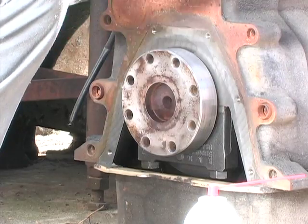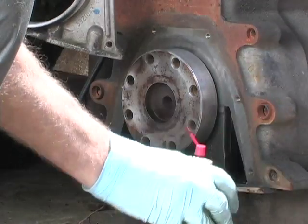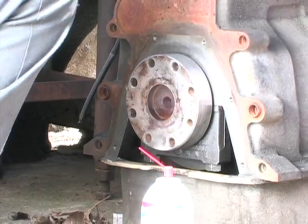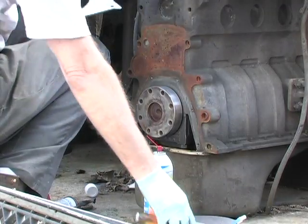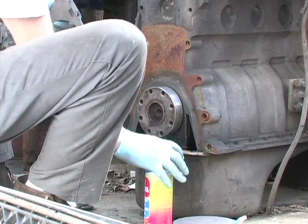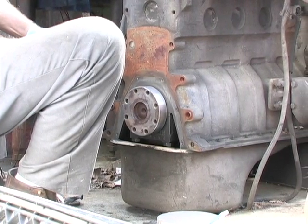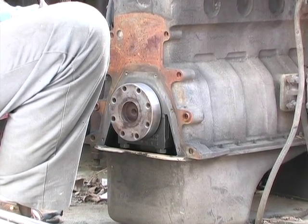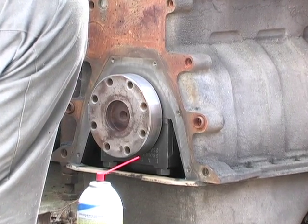All right, I've been wiping off my thing here with my B12 Chem Tool carburetor cleaner. And I got the bore all nice and clean. And we still got a little piece of gasket on the back of it there. All right, I got the rest of the gasket off. Seal bore's nice and clean. We got all this clean. A little bit of carburetor cleaner on our old gasket there. We're gonna silicone that thing back, so we want the silicone to stick. Okay, there we are.